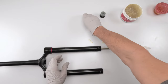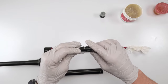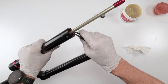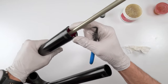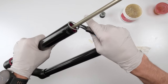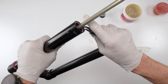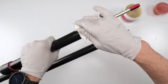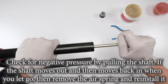All right. Then we're going to grab our retaining ring with our retaining ring pliers. You have a round part and a flat part. Round part stays out, flat part goes inside. So we take him and make sure he is sitting in his seat. Don't let it fool you if it's not, and right now, one side of it is not. My hands are slippery. Great. Okay, there we go. Now he's sitting inside fully. Make sure he is sitting inside fully. So this guy's all the way down.